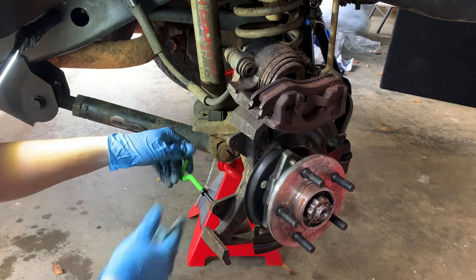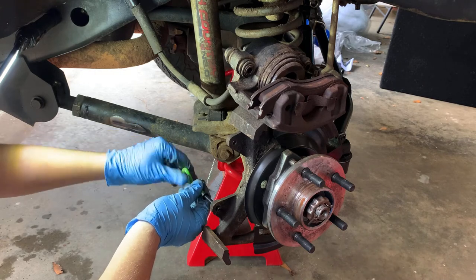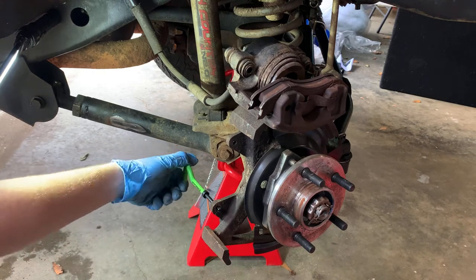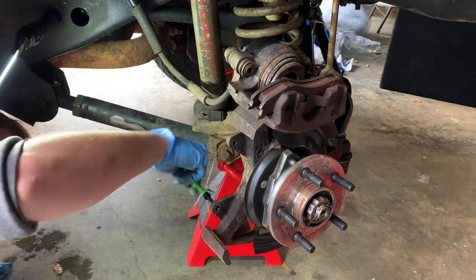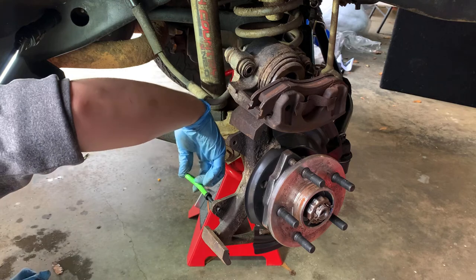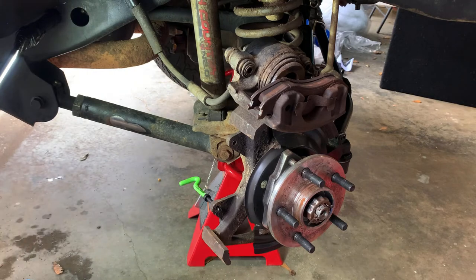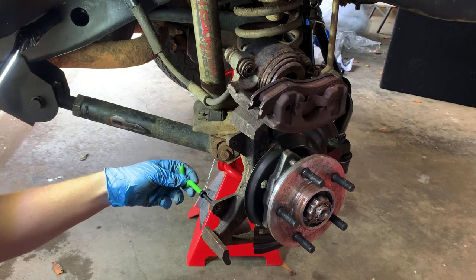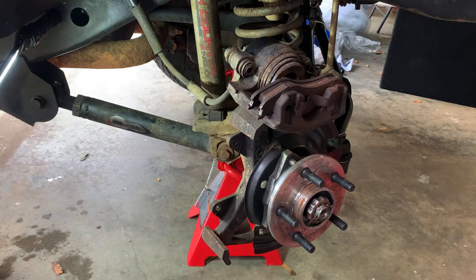We're going in now. You just want to make sure we're doing it nice and even, nice and slow. We want to put it in there until it's about a quarter turn to a half turn below the surface. So I'm going to get back here so I can see what I'm doing. Okay, we're at the surface right now, so we're going to go a half turn below the surface. That's good with me. Now the instructions, we have to do something with the tang. We pull this straight out, turn it 90 degrees, and then I like to pop the tang like that. Gets rid of it. We have successfully helicoiled our threads.